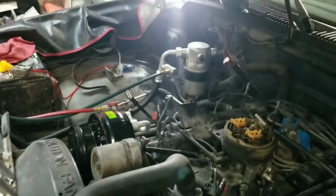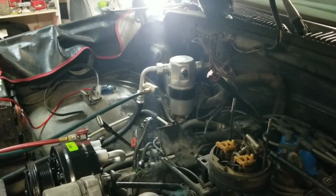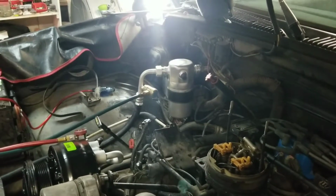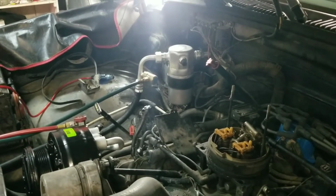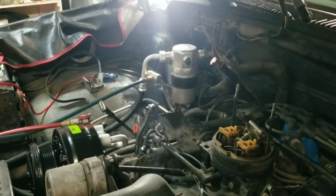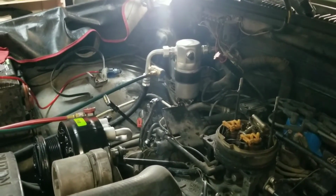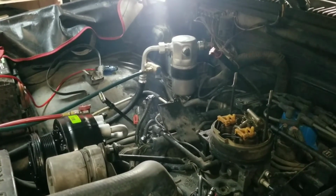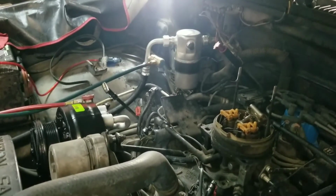All right, here's the most important thing. There is a dryer desiccant pack inside of that accumulator. It is made for removing moisture from the system. You want it to remove moisture from the system, it is most certainly necessary. If you leave this too open to atmosphere, it becomes completely useless. You have to pull a vacuum on the system for at least 30 minutes to make sure it doesn't leak out or bleed out. You want to verify your O-ring seals and everything else before you put a charge in there because you don't want to waste it, and Lord forbid we shoot anything in the atmosphere and get EPA or anybody else on us.